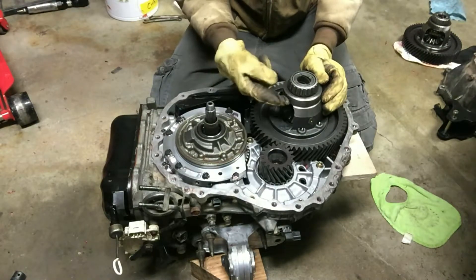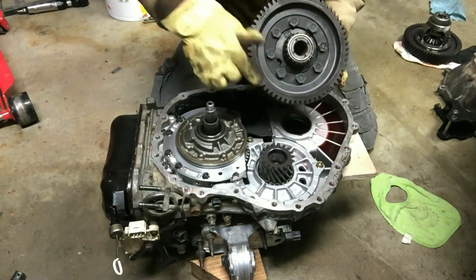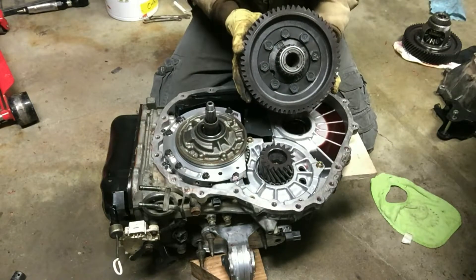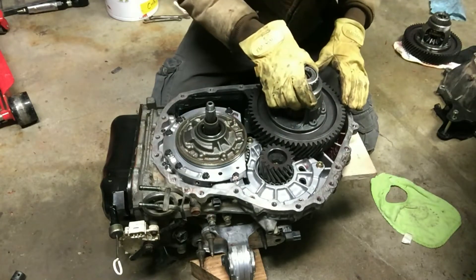The problem is I need a gear on the differential to drive my speed sensor. Luckily, the entire outer ring will come off and bolt to the other differential, so I'm just going to swap them over. Anyway, something to keep in mind: if you're swapping an F4A51 transmission from one year, make, or model to a different one, you may run into this issue with there not being a speedometer gear on the differential. Also keep in mind that you'll have different gear lash between non-matched gear sets, and they will be noisy.